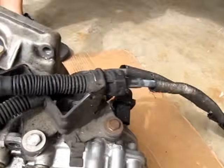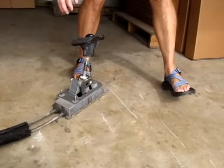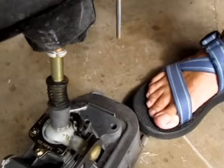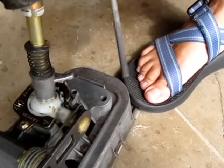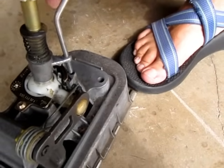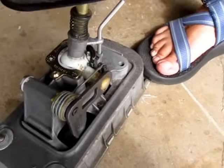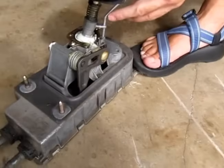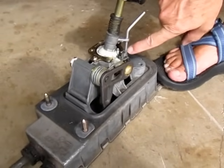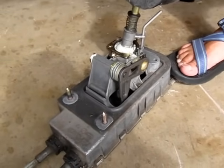We're going to go inside the car — we're doing this outside the car to show you the process more clearly. We're going to pin the shifter inside the car with the five millimeter pin. We have a whole video on this. You can use a five millimeter drill bit, which you can get locally. All of our shifters come with a precision fit five millimeter pin. It goes down through this hole and then through this hole inside the car, and that locks the mechanism into the home position.